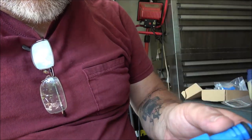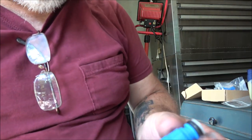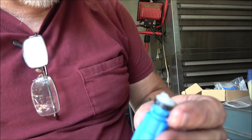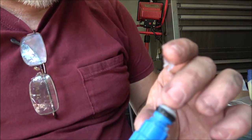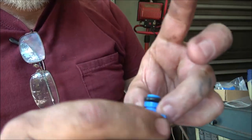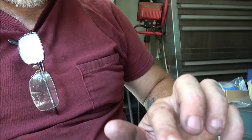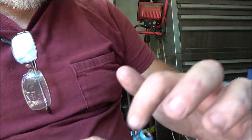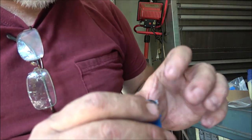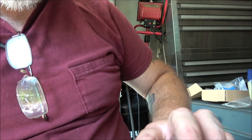What I'm going to do is put some vaseline on these. They say you can use oil — I've just always used vaseline. That one is going to go down inside the intake and this one will be going up inside the fuel rail. Get these greased up nice and good so we don't rip a seal like I did last time. That one took a while to start leaking — it wasn't leaking before.